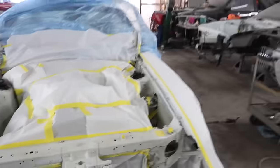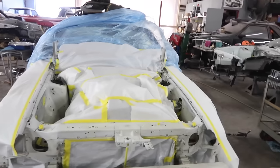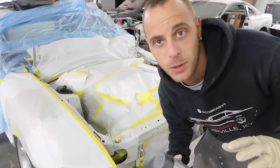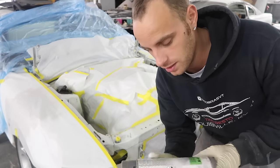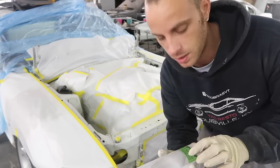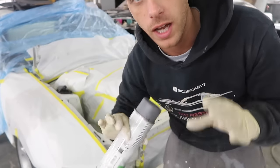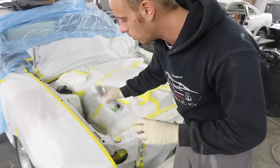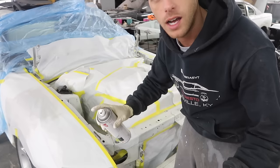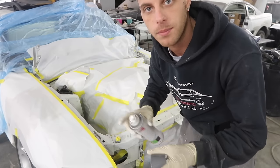All right, so I'm gonna mix the paint, tape up that little spot, and then we're ready to start spraying. All right guys, before we actually start spraying on the engine bay, to help the engine bay out a little bit and the paint to stick, we're gonna use some etch primer. I'll have a link in the description, so you just wanna mist it on. We're not trying to completely coat and change the color, because this is gray. We're just misting it on. That way it helps our paint to stick and won't chip later on down the road.